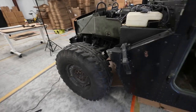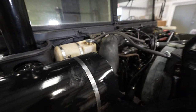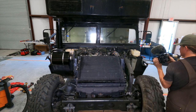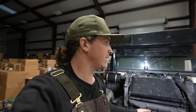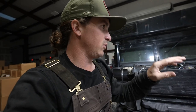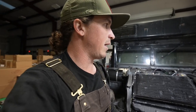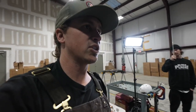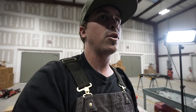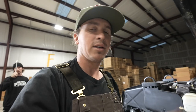Let's check out everything. Nice smiley right there. We've got the oil change and all the filters changed. The one thing I really want to do is flush the system, so I'm going to flush the radiator. I just filled it up with water. I've got three clear cups and I'm going to do a three-step process: first drain this right here, fill up one cup, then drain the whole system, then put some radiator flush through the system. I'll actually drive it around for one to two hours, really let it heat up and cycle through, then drain that. That'll get a lot of the crap out, and then we'll do the final fill-up and it'll be good to go.